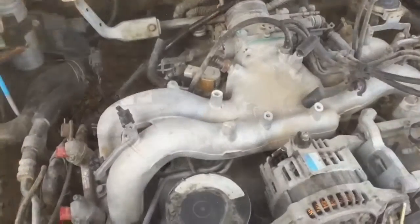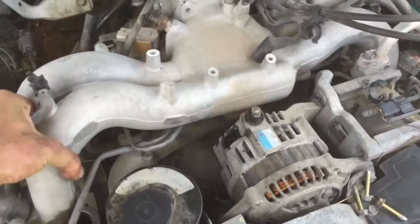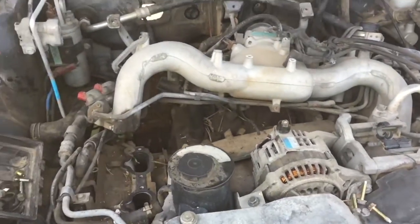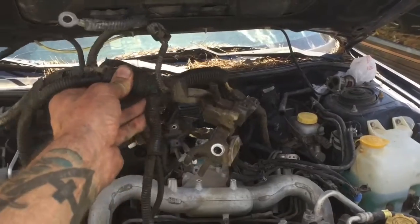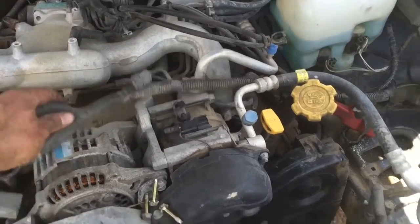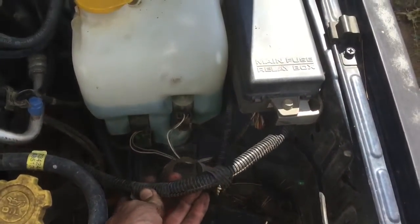Now we need to take a look at the engine harness. After removing the bolts that hold the intake manifold, it can slide up and down pretty freely, and once you do that it's really easy to get the engine harness out. You'll also want to get the alternator harness and the AC connection - I generally just cut that harness at the fuse relay box. That kind of wraps up the harness pull for a JDM engine: basically taking everything you can from the USDM car, as many sensors as you can locate, and transferring that over to use the JDM hardware. Thanks for watching.